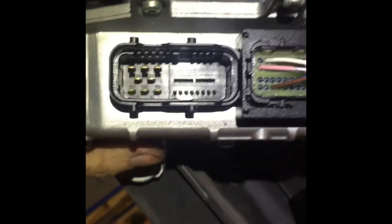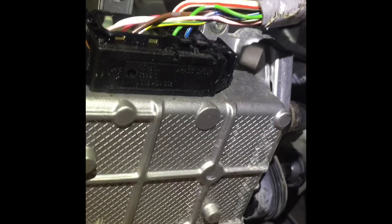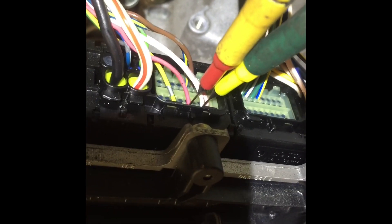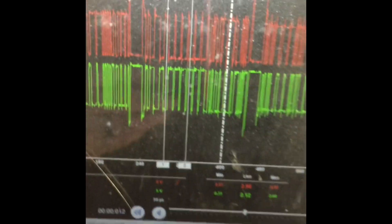It's slightly moisturised — slightly wet inside the pins, not in the plug itself. I've disconnected that block connector and I still have communication. We're starting to get somewhere because I have communication at this point. I'm back-probing the CAN wires — there's a white and a red one that I'm back-probing. Those are the CAN lines.